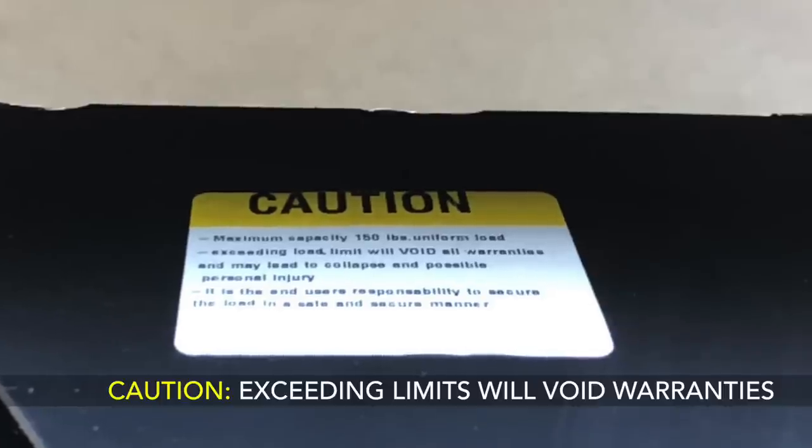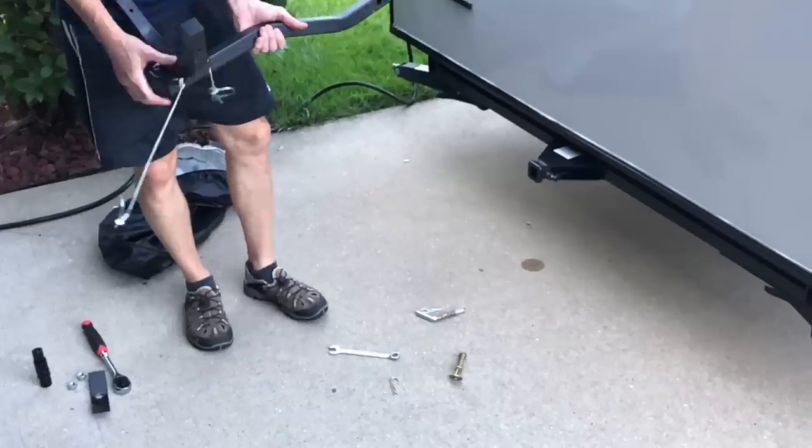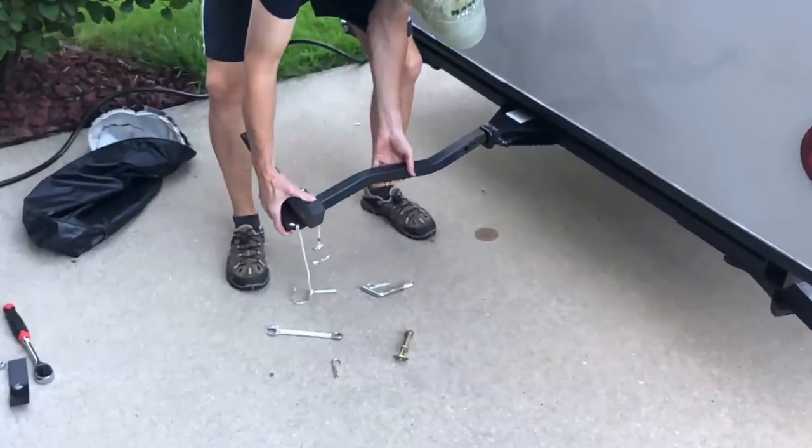Check your weight limits depending on your year — you may not have that much capacity. The 2017 R-Pod 179 has 150 pounds. We weighed everything: the spare tire hitch was about 10.8 pounds, and the tire itself fully inflated was 46.4 pounds, for a total of 57.2 pounds. With a 150-pound limit, that left us almost 93 pounds of remaining capacity just with the spare on there.